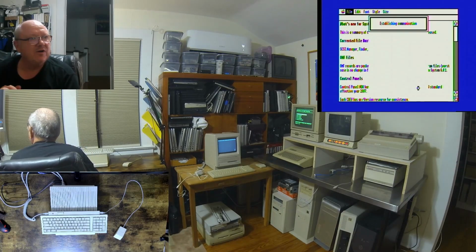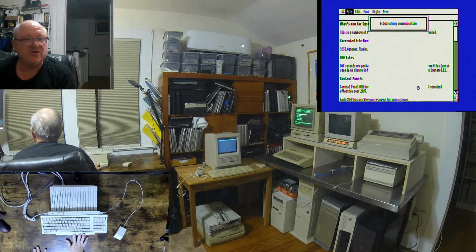And that took a little bit of learning for me, because I just assumed, like on the Mac, you install the Macintosh software, it knows all about the printer. On the GS, installing the AppleTalk components is actually optional. If you want to install the GS from the original floppies that would have come with GSOS, when you're doing that install, you could have selected the options to install AppleTalk Network. But if you're like me, you might have used a hard drive image that you're booting from, that you've downloaded from the internet, and that might not have it installed, which was the case here.